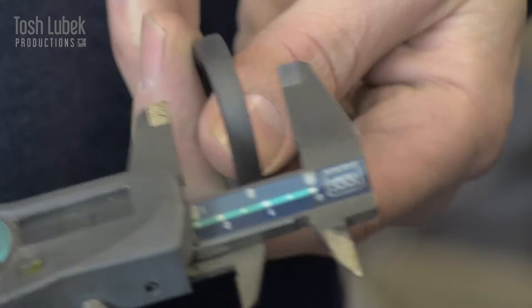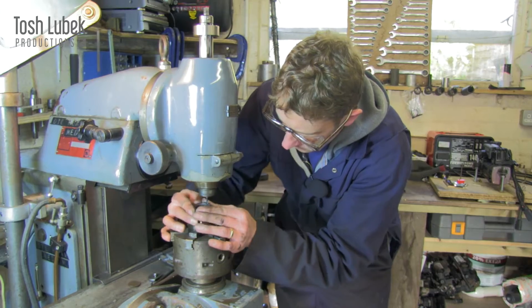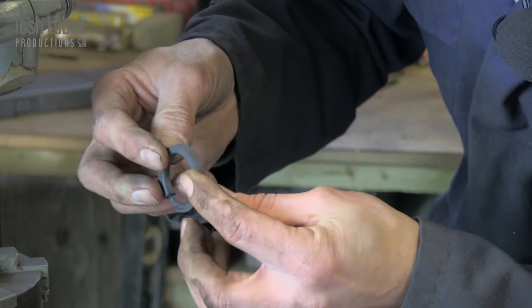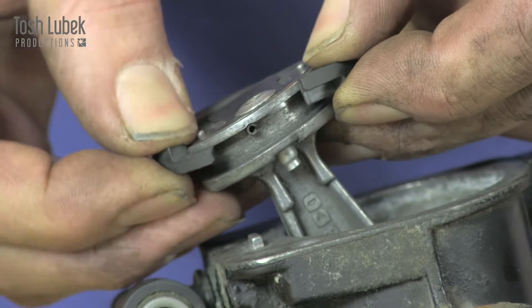Nobody seems to make just single parts for you to repair. So I measured the old ring, realised it was worn, so we made some prototypes a few sizes bigger, different profiles as well, different materials. Once I had about four or five prototypes, I found the best solution and fitted it back to the car. That was really the test to see durability and how well it performed — the compressor worked like new again. It was a good success.